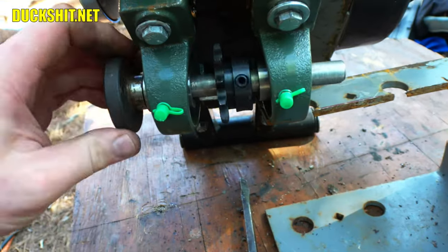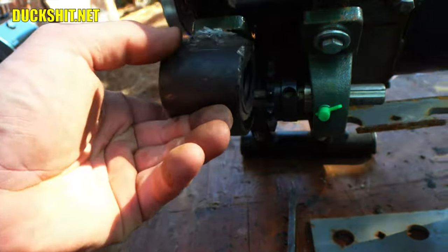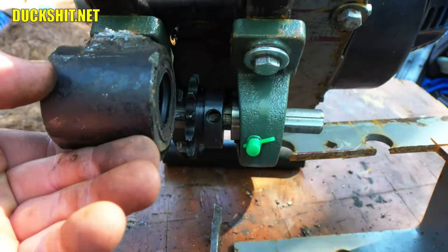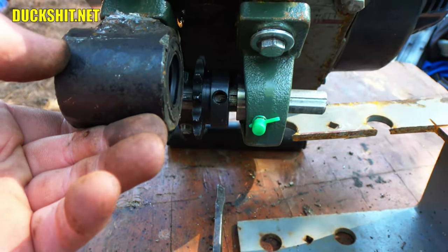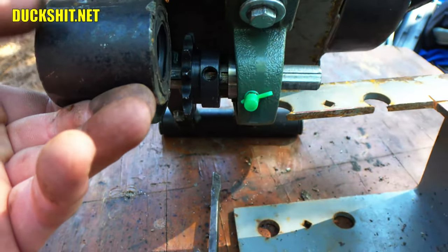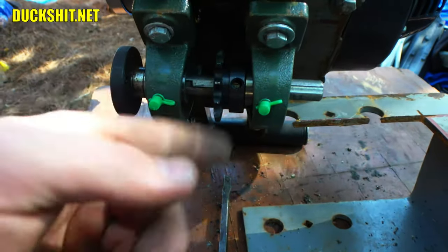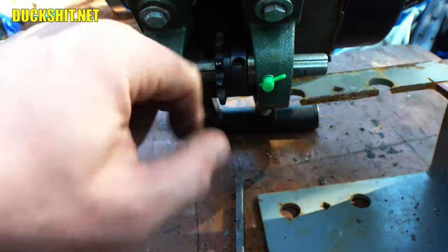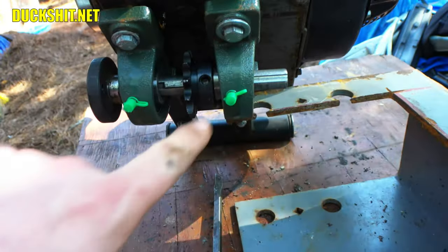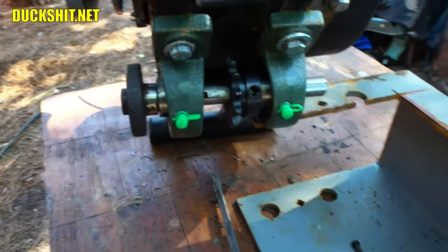As we experienced before, the key would split. But this is the piece that came off of here. And then the sprocket would usually just shift off to the right, slightly from where it's at, so it might come over just a little bit more. And if I'm wrong, then I have to turn the sprocket around and figure out what I'm going to do, or maybe even machine it down a little bit, or reverse this bearing, because this bearing might be pushed out too far. I wanted the grease zerks towards the back, so they're easy to get to.